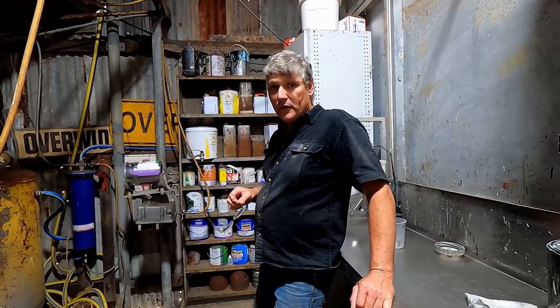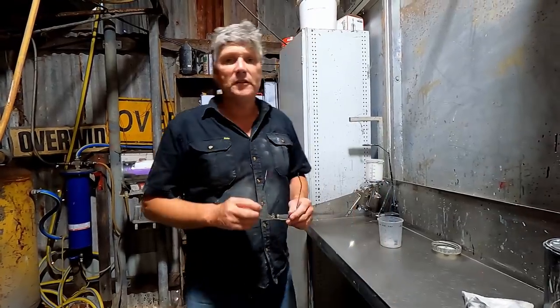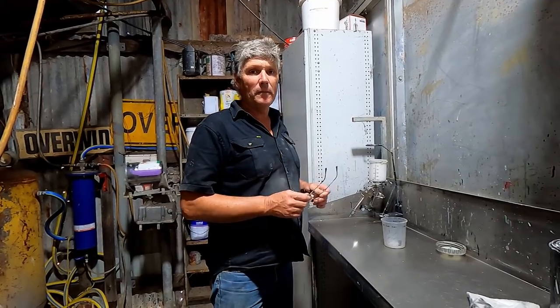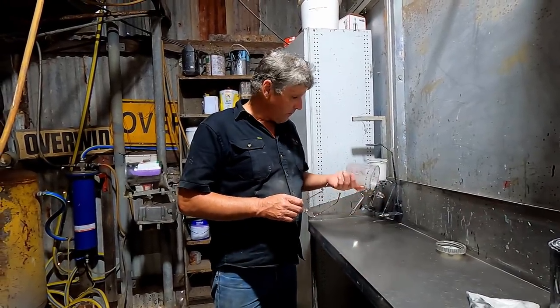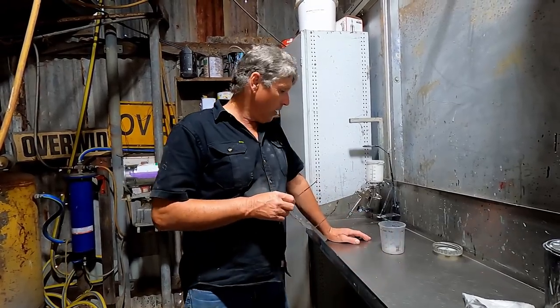It's just on the shaker at the moment, so we'll give it a minute or so to rattle around a bit, and then we'll give it a good stir. But I need a little bit. The epoxy primers are more to go over the bare metal areas, and we don't actually have a lot of bare metal, so I'll mix up the minimum amount I can in this mixing cup on the 4-to-1 setting, and I'm hoping that'll be enough.